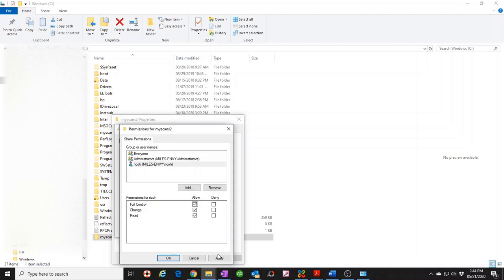Now open your browser. I'm using Chrome — I recommend everyone use Chrome. You can download it if you don't have it; it works flawlessly with copiers. Internet Explorer sometimes has hiccups and weird glitches. Remember the IP address of your copier that I had you gather? Go to the URL bar in your browser and type in your copier's IP address. This takes you to the back-end web interface of the machine, where you can control the entire copier.